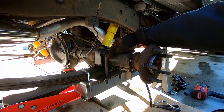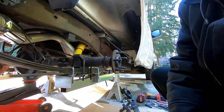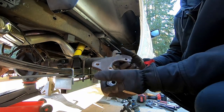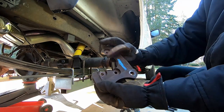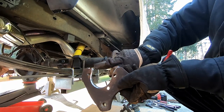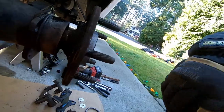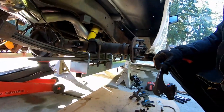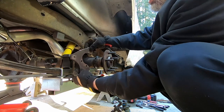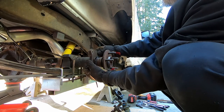I'm going to go ahead and weld the tab on for the new brake hose and fix the nick. After sorting out the camera, we're ready to start putting this thing together. On the revised brake caliper bracket, you have to grind this bevel bigger than the factory bevel — I've already done this one. The reason is to clear the weld for the caliper mounting flange. I fixed the little nick I put into that flange as well. This is why we have to notch the bracket — so it can slide over the axle tube and bolt on nice and flat.